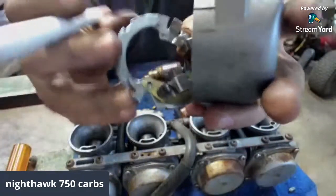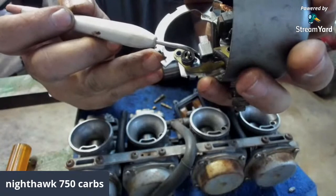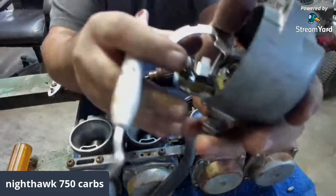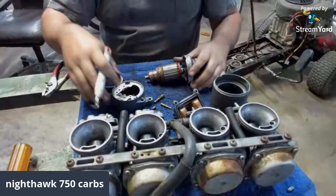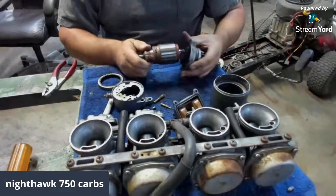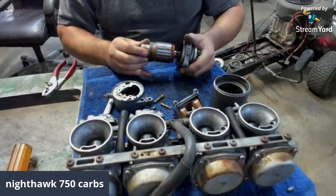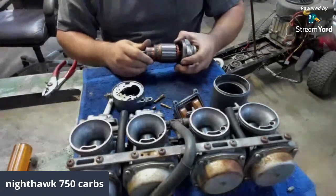Hang on. Class 101. There we go. This spring right here connects there to this. Okay? Goes right in there and connects. The other one broke off and fell into the bottom of the case. It broke it. So I could probably get replacement springs, but with this doing whatever it's doing on this side, not engaging correctly, my starter's junk is what I've come to terms with. Actually, this goes in there like this. So this starter is junk. So I got to order another starter, pretty much.